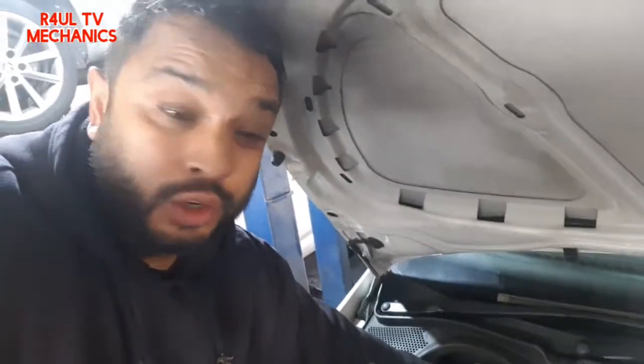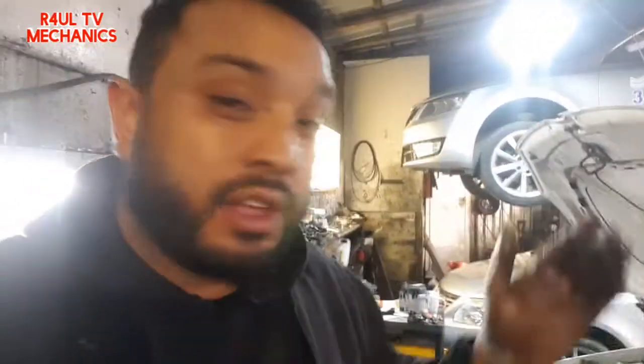Okay, and then what I'm going to do is go inside the car and pump the brakes. Make sure you pump the brakes before you take it out on a test drive, because the last thing you want is to not pump the brakes, take it out on a test drive, and the first couple of times you press the brakes, you'll have no brake whatsoever, all the way to the floor. So make sure before you take it out for a test drive, you pump the brakes, get them nice and hard, nice and solid, and yeah, ready to go.